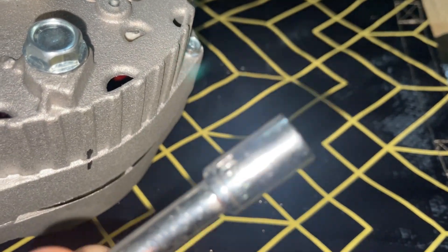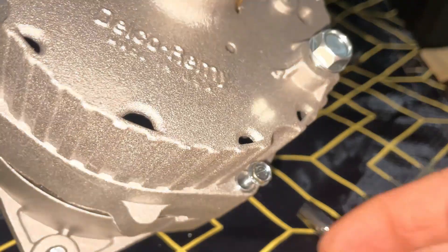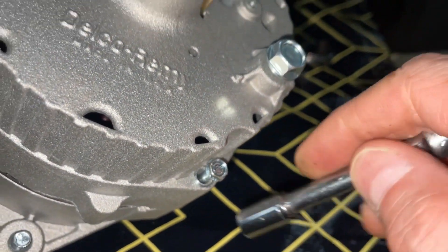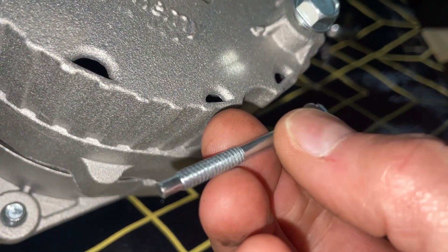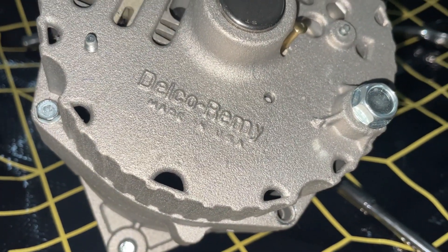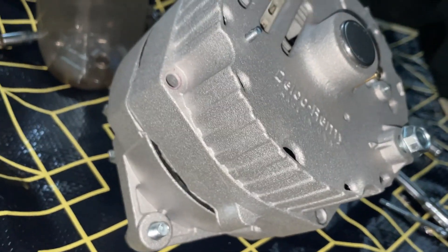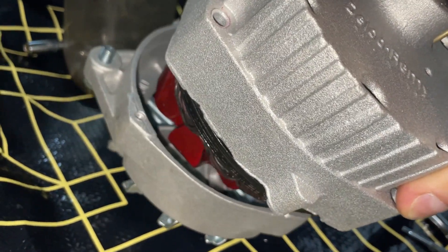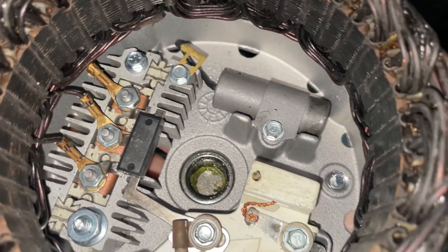Scratch the 8mm — 5/16ths actually fits a lot better. I'm surprised it's not metric, but in this case it's not, so I'm going to use 5/16ths. Taking the first bolt out here. It's a very unique individual bolt, so just put it aside and don't lose it. There are 4 in total, so just take all 4 out. And it just lifted right off with one hand. Everything looks okay in here.